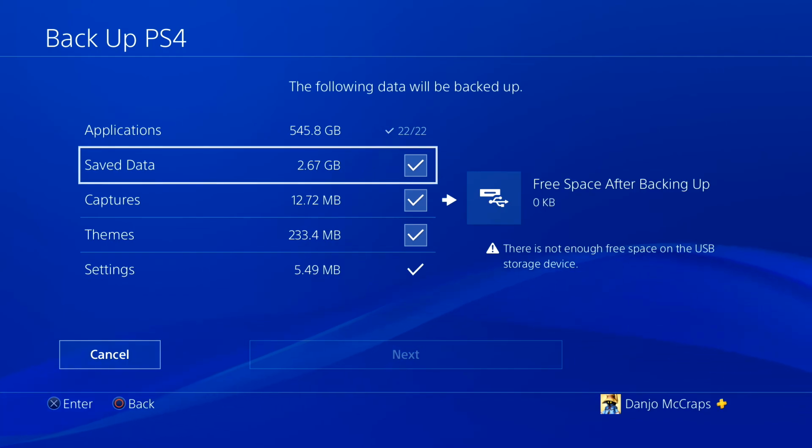This could be because I have an old USB 3.0 USB Type A thumb drive from PNY, and it's not very fast, especially for write speeds. That's probably why it was slow. If you're using a fast external SSD already, or a USB 3.1 thumb drive that maybe has speeds comparable to something like a SATA 3, you're probably fine. And if you went ahead and cloned your PS4's stock hard drive to your new hard drive, you don't have to do any of this anyway.